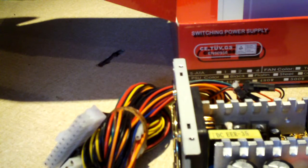This thing's definitely going to need some attention. I can see something right away that gets my attention — look at these capacitors. They say they're OST, rated 4700 microfarads, but that has me wondering if that's legit or not. There's a very small spot for a line filter. And look at these diodes — we've got a 4-diode arrangement here, which I'm not really liking. But then again, the previous one had the same and it worked just fine for all these years.